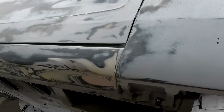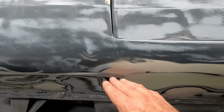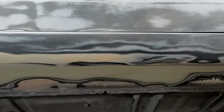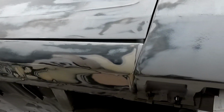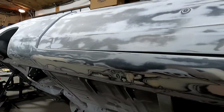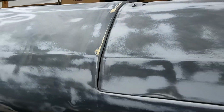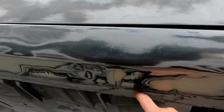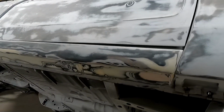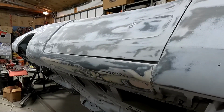Okay, so last look at all of the crazy bodywork on the stinking rocker. You can see that's the original pink Bondo or U-Pol, whatever I used to transition that area. But all that's new, all the green is new, and everything is super slick all the way down there. You can see the bare metal is right there close, and then there's just primer, so it's not got a whole lot. I'll prime this and then prime that, and I softened this door edge because it was just like a razor blade. So final stuff's getting all the little, all this is super slick all along that crevice. I don't want any crusties anywhere. So this is the last look before primer, and I'll do the same on the other side, and that should be the end of the first video of final prep work.